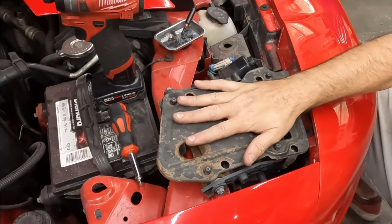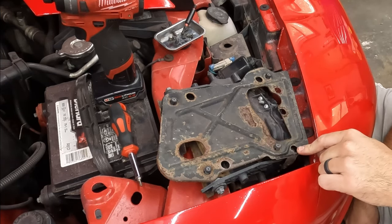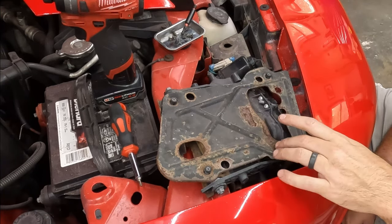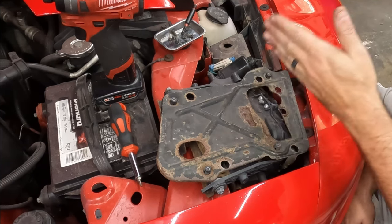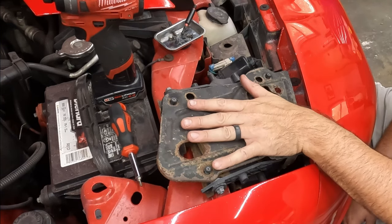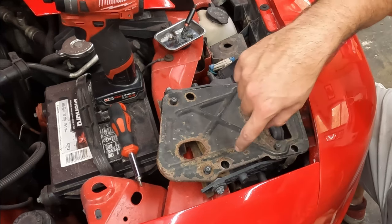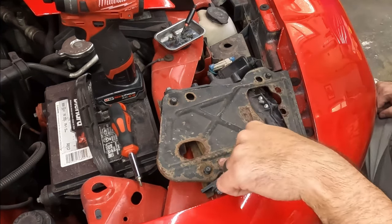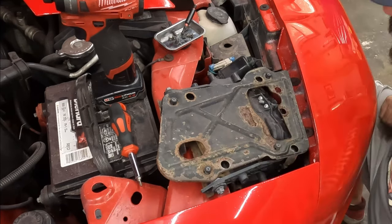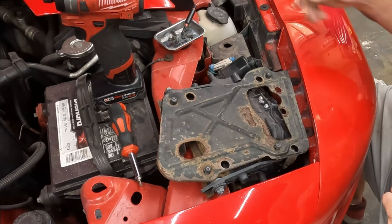You've got to have everything off to get back to this. There are four screws on the corners here. On the LS models, there are five — they're more horizontally oriented, so there are more on the later model, the '98 and higher Firebirds. On this one, there are four corners and that gives you adjustment in a leveling kind of way. Down inside here are four screws in holes that give you movement this way and this way — they go at an angle and you can adjust them independently, at least a little bit, which is what we need.